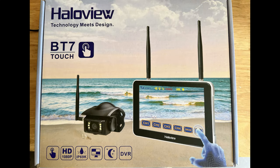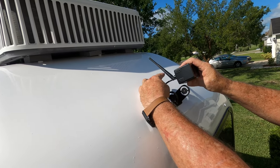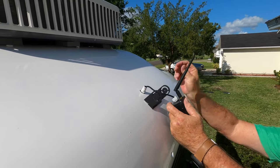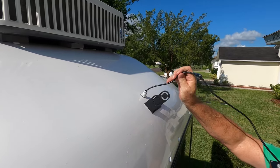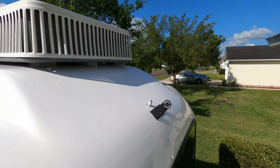To begin with we'll go ahead and show you part of the original installation because the cameras are the same. First thing we need to do is remove the old camera and we're just going to use the same connector that goes through the actual trailer here. Just unscrew it, pull the wire back out — we've already cut it on the inside.